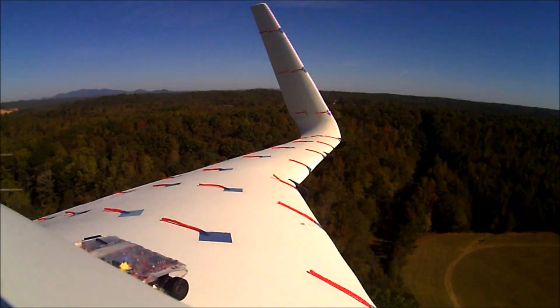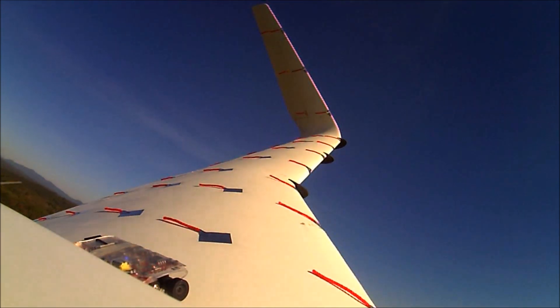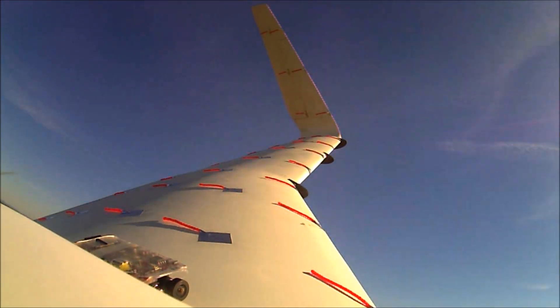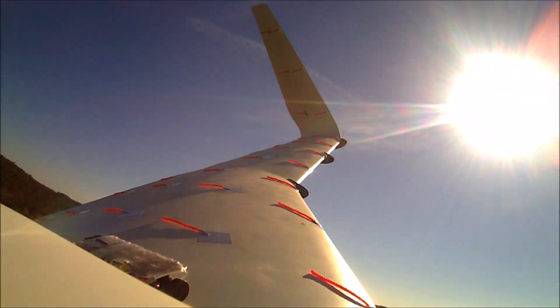In the transition from the wing to the winglet, there's no turbulence whatsoever going on in that radius, which is really good because that's what we were worried about — the spanwise flow was what was causing our Dutch roll problems earlier.